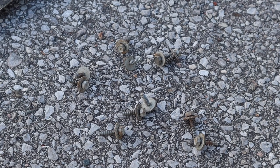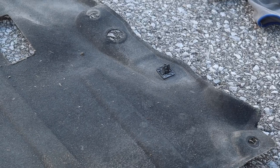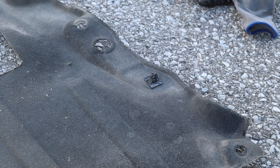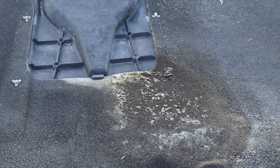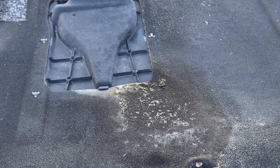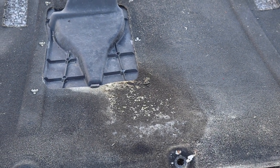All right, so there are 11 10 millimeter screws. They are all the same length, so don't worry about mixing them up. Those plastic tabs, just leave the portion you pulled out a bit attached to it and slowly pull it out. Okay? There's two of these bolts at the back that you might miss at the beginning. Now, just on a Lincoln, looking underneath here, this looks like some kind of oil slash coolant crust that was underneath this car. So this is something we'll keep an eye on if we continue to go forward with working on this car.